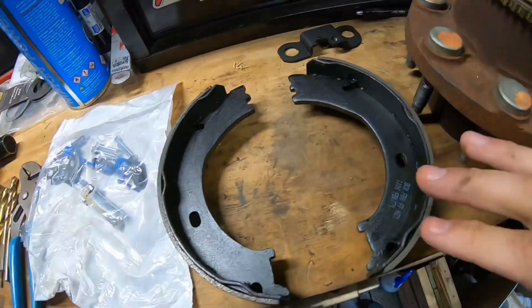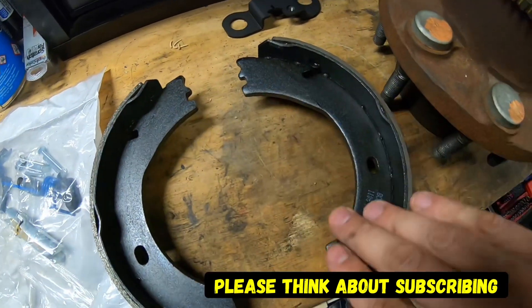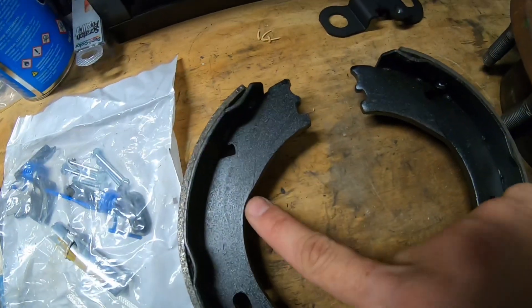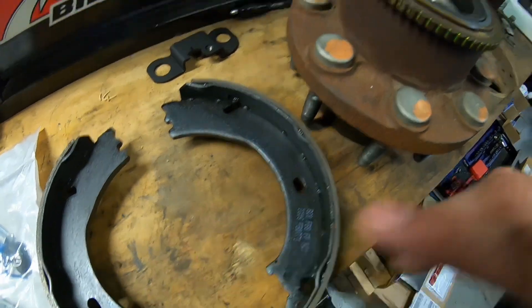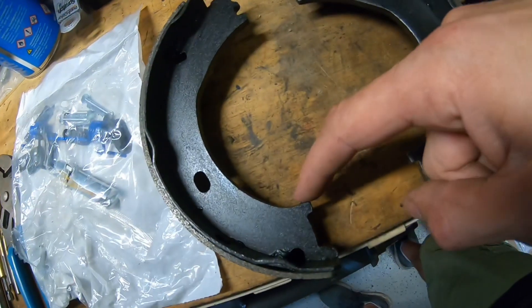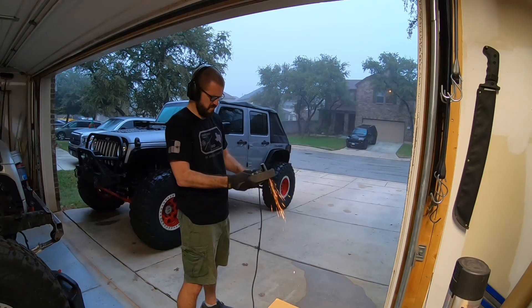This is a new set of brake shoes and I haven't ground these yet — they are not perfectly round at all. What I'm going to do is open up the areas that need it. I'll open it up here a little bit and take a little bit of material off the inside. But that's usually not the problem when it comes to clearing this tone ring. The problem is usually right up here at the top corner and right down there at the bottom corner. I'll remove a little material there as well. The only way to truly know if you've taken off enough is to test fit it. I just hit them with a flap disc and open them up.